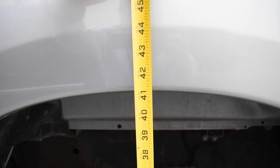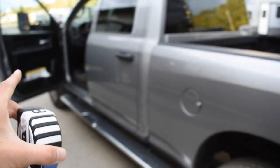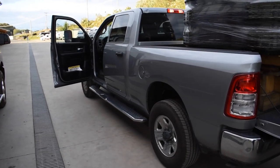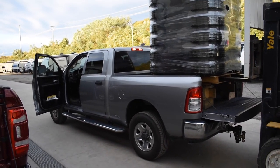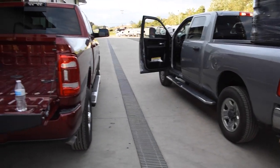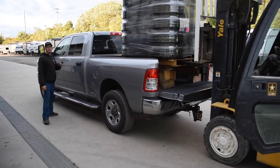After the airbags inflated, we're right there at like 41, almost 41 and a half inches. So the airbags 100% help — it got the rake back on the truck and pretty much went back to the way the truck was without anything in it. So with my 2500 I'd be towing sitting kind of squatted with like two-plus inches of lean, whereas this 3500, once you start the truck and the bags realize there's weight, it picked right back up to pretty much stock. If you tow a lot or haul a lot, you definitely want to consider the bags — they are available in the 2500s as well. The only difference is you still get coil springs with bags in the 2500, whereas you get leaf springs and bags in the 3500.